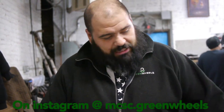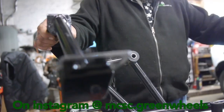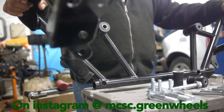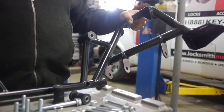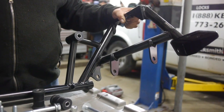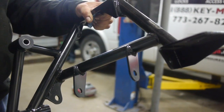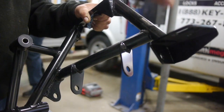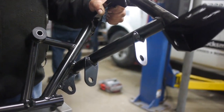Basic thing, it's solid, nice tubular design. Sturdier, lighter, and with this you avoid cutting and dismantling and disfiguring the original crossmember. Not that it really matters, but if you don't use this setup, you'll end up having to cut off this whole section in the original in order to let the header pipes come down this way.